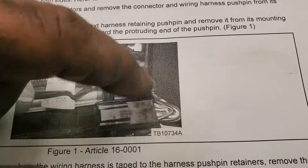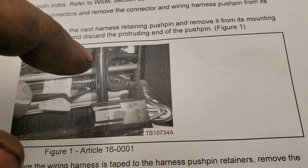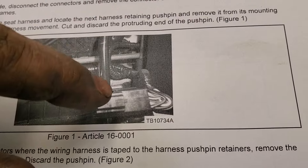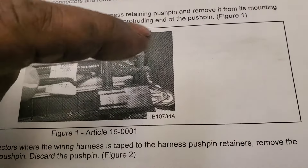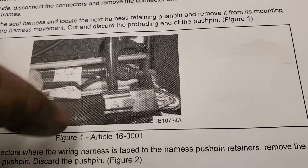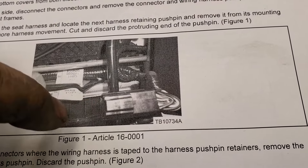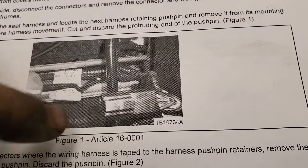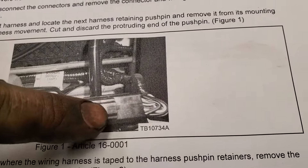The problem is here and here. There's too much stress on this curve right here. This tension pulls on it so much. The connector that comes this way and plugs into it is pulling on it all the time and it doesn't leave a good connection.